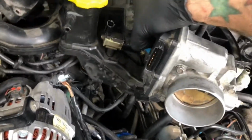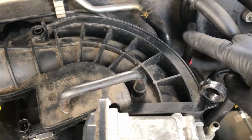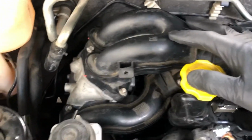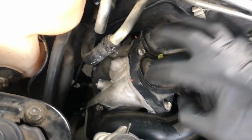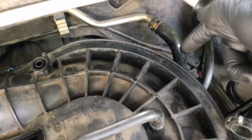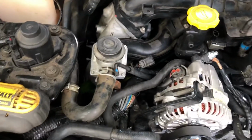And again, the way you pulled it out is pretty much the way it's got to go back in. And then pop the intake back in its position. Just got to watch this line right here. It's kind of a hard plastic, and that's what was kind of blocking me from maneuvering it in the correct area. Went ahead and put all the bolts in. You got the 3 here, 2 here, 2 in the back, and you have 2 back here. So, of course, I pulled them in and went ahead and took that 1/4" ratchet and I snugged them in.